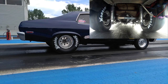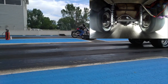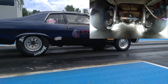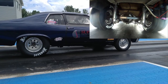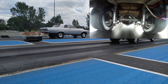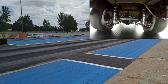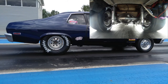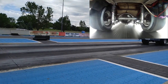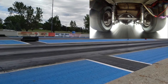The front end of the car plays a key role in transferring weight to the rear tires, and with the front end coming up, the vehicle's rotation around the rear tire may appear that the car is squatting. The weight being transferred may slightly compress the rear springs, but we must tune for separation. If your slow motion videos show the wheel moving back up towards the fender after the hit of the tire, you need to increase the compression valving, because if the wheel and tire are moving up into the fender, they are moving away from the track.